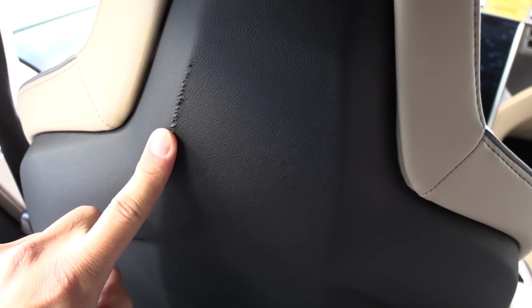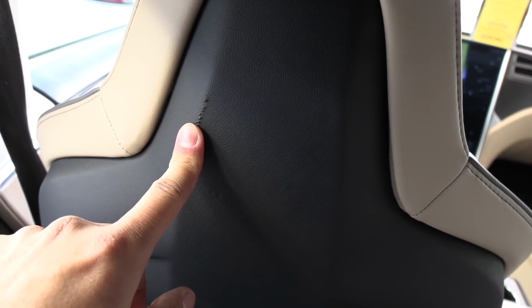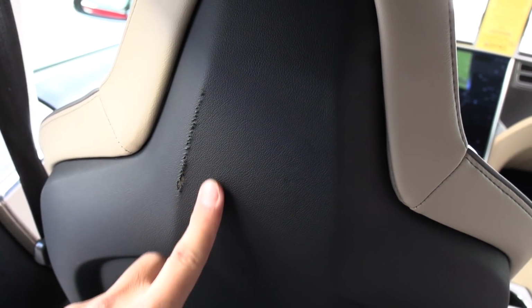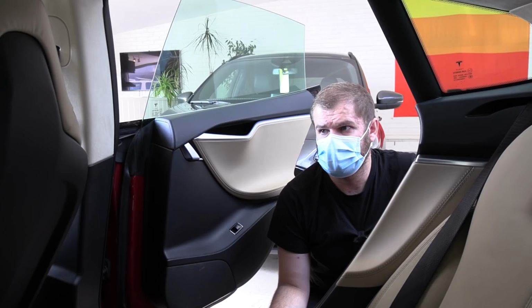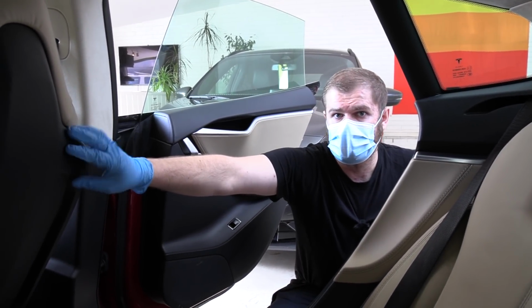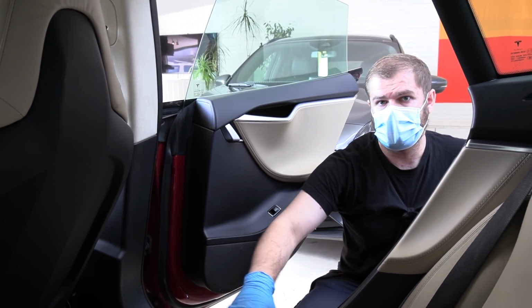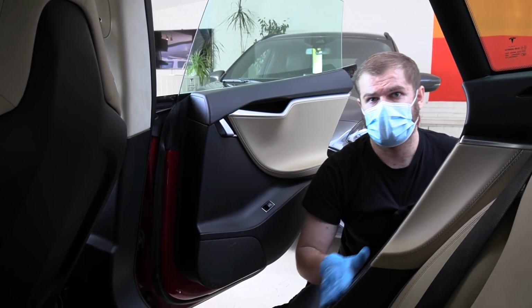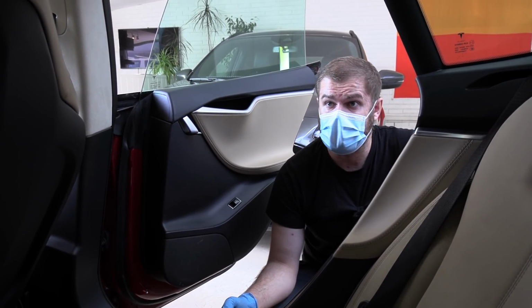We just have to remove those rough edges around there, and then we're going to fill up with a special filler. And then we're going to follow the procedure that's called matching the grain. So that means when you put in a filler, it has a flat part to it. But with our process, we're able to recreate the structure of the material. So once you repaint it, you see one uniform grain instead of something flat in the area where it's been repaired. So that's something we definitely can do another time. Right, great. That was pretty awesome.